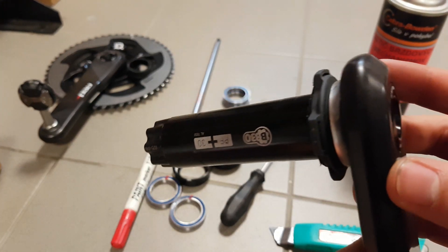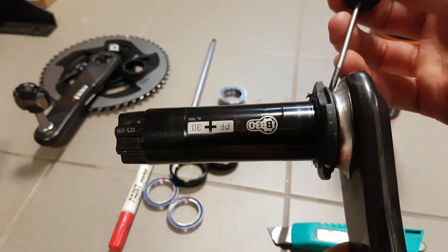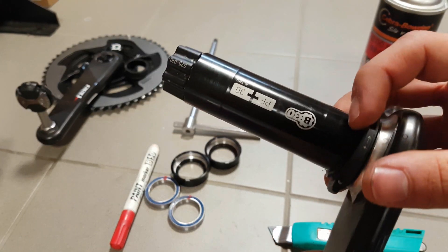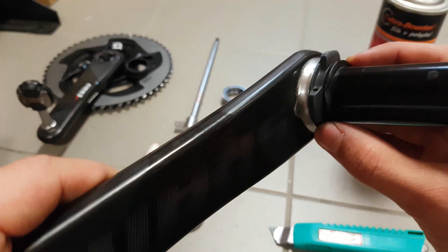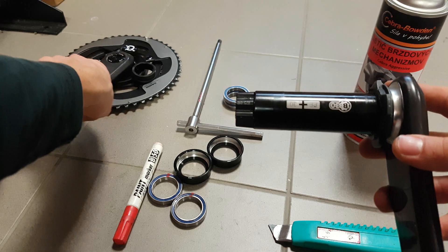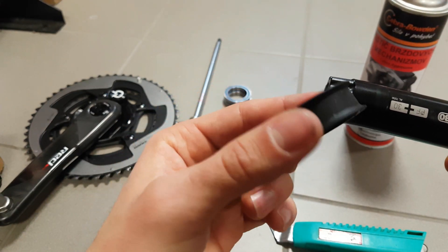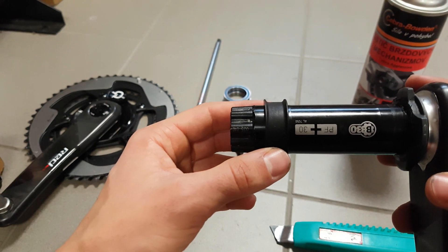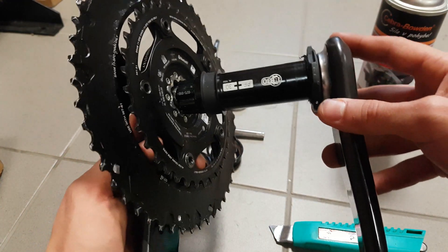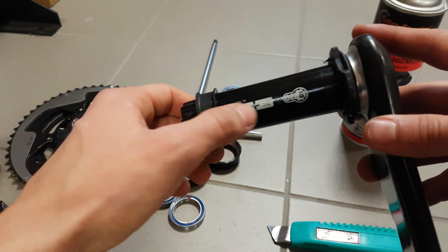In order to fit the BB30 crank set power meter here, what I needed to do was to remove the aluminum spacer, which is wedged between the preload adjuster and the crank arm itself. You can do that just by undoing the tiny bolt on the preload adjuster and removing it. Then use a bit of heat to take down the plastic sleeve that the thread has on it for the preload adjuster, and then remove the spacer itself. I also made a tiny, very thin little spacer to make the crank free of play, and this way you can use the standard wide spacer that comes with the standard cranks. You put this one on the drive side and you can also use the standard dust covers.